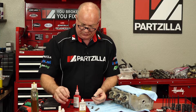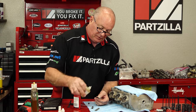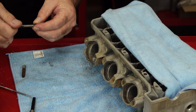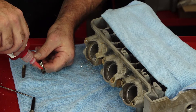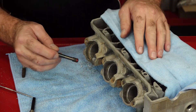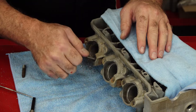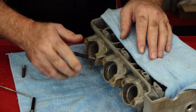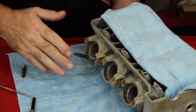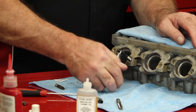One of the main things I like about the Time-Sert system is it has a flange at the edge of the Time-Sert itself, and you use a countersink to accommodate that — so it ends up being flush all the way at the top. Here's the critical part: making sure that this goes in perpendicular. This is what you want it to look like right before you put in the Time-Sert itself — countersunk, nice clean threads going all the way in at the right angle. On the installation tool, put a little bit of oil so it goes all the way through the threads easily. But conversely, on the outside of the Time-Sert, put some high-temp threadlocker.